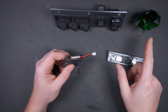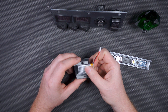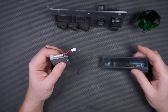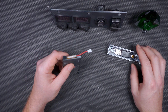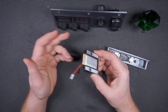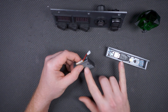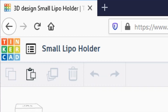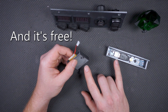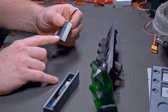The other thing is the batteries we use to power the whole mess — these little LiPos. I needed some way to hold them against the side of the housing, and simply like that — I mean how cool is that! Nice and simple. These two parts I could actually do on my SLA printer, so heat would not be an issue. These will probably never overheat and are not under any significant mechanical stress, so they're just fine. I could have machined this out of a hunk of plastic, gone out there and froze my butt off and spent hours — but these two parts combined took me less than an hour in TinkerCAD, which I think is designed for kids and students. It's a Fusion 360 online product.